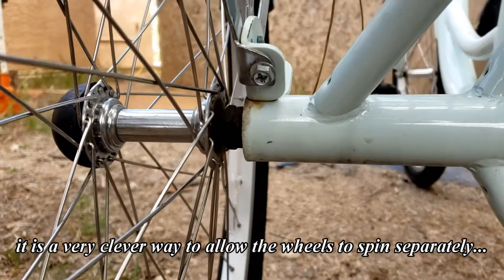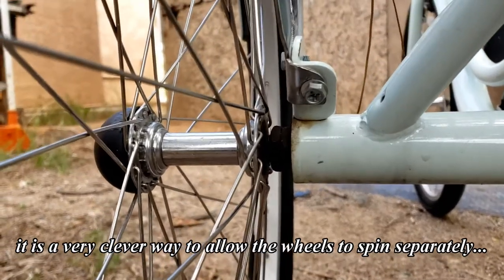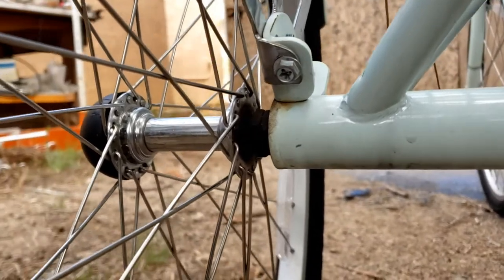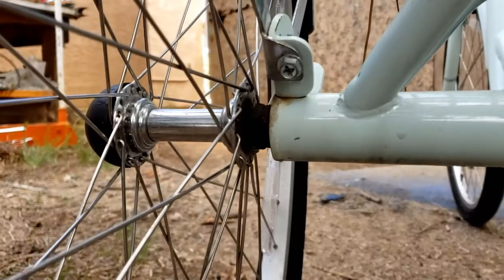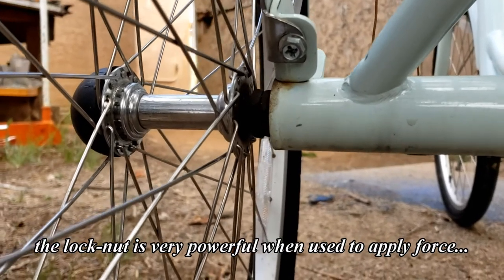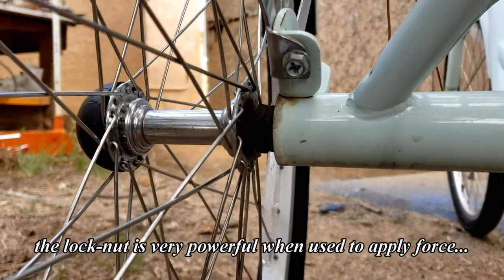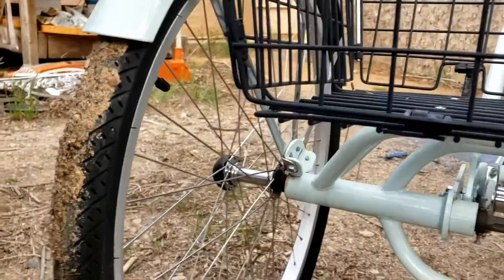So most of the time they're spinning together. Now then, when you hit the brake, if that nut is out there in contact with the hub, the wheel will keep spinning and the axle will stop. And the nut, if it's in contact with the wheel, will screw off and push the wheel off the axle, which parts the axle, splits the axle, and cuts it right there.